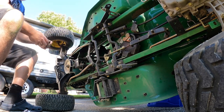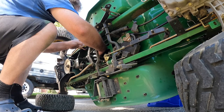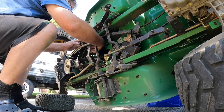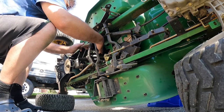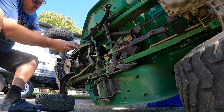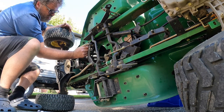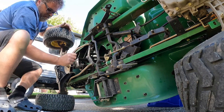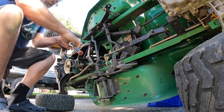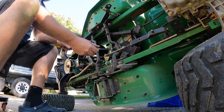We'll slot this new pulley on in a matter of seconds — careful, easy, gentle. There we go, that's on. Belt on the right side this time — there we go, that's on. Slip this all the way on like that, then slip on the piece that holds the spring, slip the bolt back on, and tighten her up. Done in minutes. We've already found the bad pulley, but we're gonna change them all since we're this far.